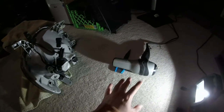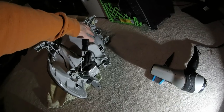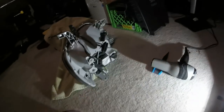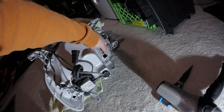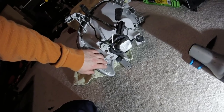It's Friday evening, so I'll run the hair dryer for a few hours, then swap it out for a regular fan overnight — I'm paranoid about leaving a heated device plugged in. I'm using the warm setting, not hot, because I don't want to risk damaging the paint on the inside of the headlight. Make sure the hair dryer is lined up as straight as possible with the larger opening for the daytime running light, then confirm with your finger that air is coming out the other side.